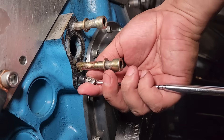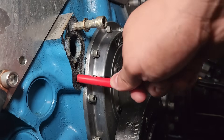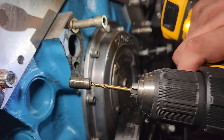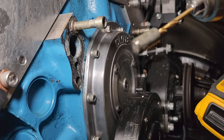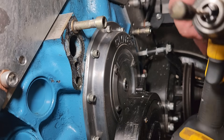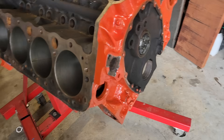It was a little tricky to get out. I tried a couple different magnets and a small screwdriver, but what ended up working was drilling a small 1/8-inch hole and wedging the drill bit to pull it out. That took some doing — I wasn't sure I'd get it. This is a hardened dowel, so it didn't take a self-tapper, but the drill got through it. As you can see on the bottom, I didn't go all the way through, so the block is safe.